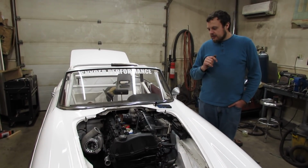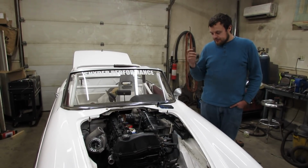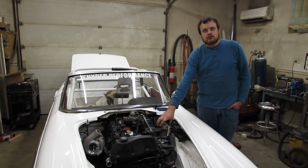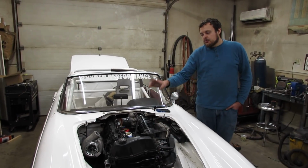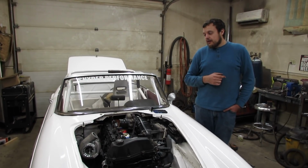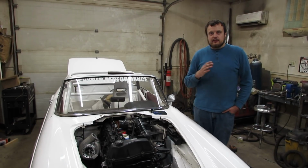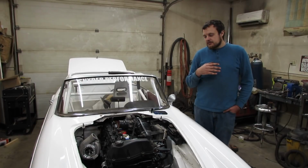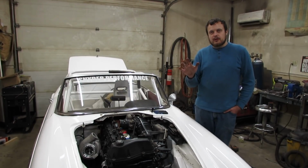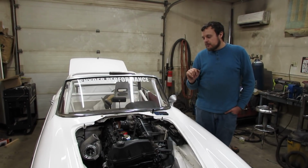As we found out in Richard Holdner's videos, in a naturally aspirated form, the VVT control could literally just be a switch, meaning that you could command all 25 degrees of exhaust cam retard, and it doesn't really increase or decrease power over the rev range. I think it was around 2500 RPM. Just command all 25 degrees, and it'll put it where it needs to be to make optimal power.